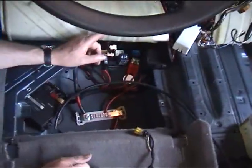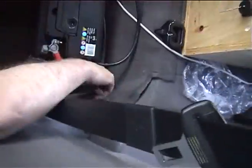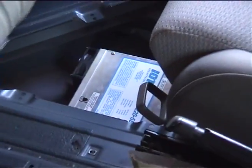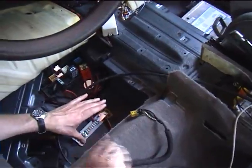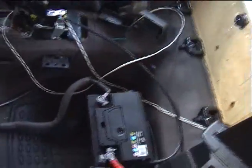The heater's going to go back in there. I can show you that a little bit later. I moved the 12-volt battery to here, taking it out of the space at the back and rerouted all the wires so that there's no cabling going through to the back at the moment. That'll become fairly obvious why. On the other side here, the DC converter is going into the little cubby there, so that's quite nice. So in the end, what I want in this one is to put in a small 12-volt battery and get rid of the big 12-volt battery so that we don't have that anymore.